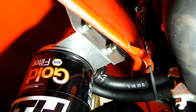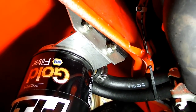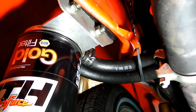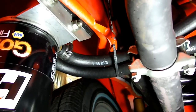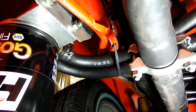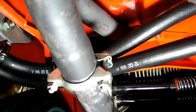Here is a look at that bracket from underneath. You can see the two mounting bolts right there and the high pressure hoses. Now the tricky bit is we don't have too much space in there. You can see that there's an exhaust pipe right there, so those hoses have to clear. We have to be very careful on our routing.